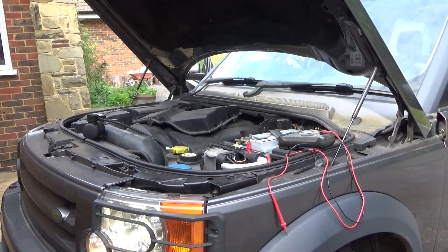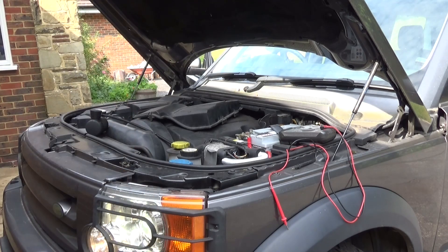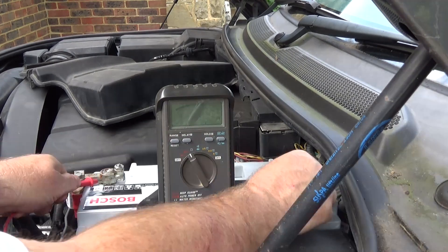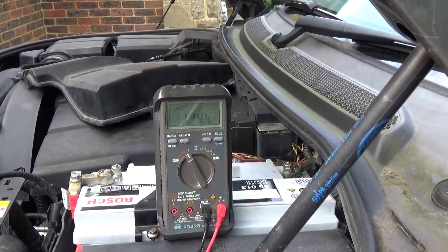It's my intention to try and flatten the battery of this car to give the jump starter a proper test. I've got the headlights on, a 12 volt compressor running off the battery, the radio on, and the heater fan on inside the car just to drain the battery. I'll take it down until it won't start and then we'll try the jump start. That has taken an awful long time but the battery is now flat — in fact it's showing 7.6 volts, so it's more than flat. I'm going to turn all the lights and everything off and then try to start the car. That's what a Land Rover sounds like when it won't start — so that is well and truly flat.